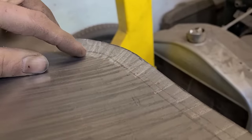All right, I got this piece of trash welded on both sides. And some of you may have noticed by now there's a huge giant dent here that I've chosen to conveniently ignore. That should have been taken care of before we welded any of this in, but we didn't. The reason is it's all closed off from the back, so I got no access there, which means I gotta use the unispotter on it, which means I gotta get this rusted pile of garbage bumper out of the way. Which means fighting with a bunch of frozen stuck carriage bolts. So we're gonna deal with that now so I can fix that, which should have been fixed a long time ago, but we didn't. So do as I say, not as I do.